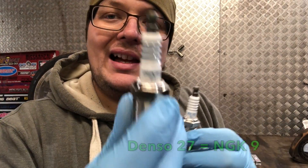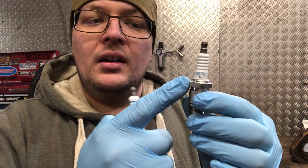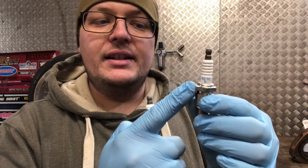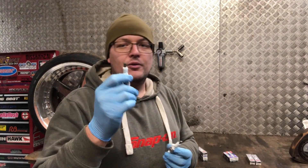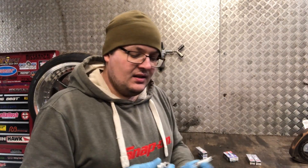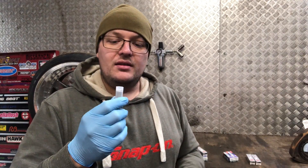So you're running two heat ratings lower than what Mazda recommended. Even the colder plug that was fitted to the RX-8 in the early days was still a heat rating 8, so make of that what you will. I wouldn't normally recommend racing plugs for a street application. We'd normally recommend NGK plugs, but if you are tempted to go with other manufacturers, make sure they are rotary-specific, and make sure you get the correct heat ratings for your application.